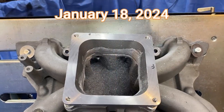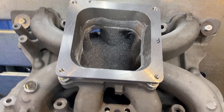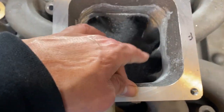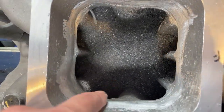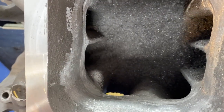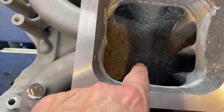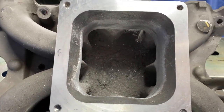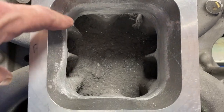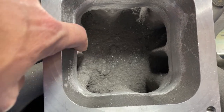Here's a little update - I think I got probably a total close to four or five hours on it right now, which is crazy. I had a quarter of an inch on this side to remove and like a sixteenth of an inch on the front and back. It's looking good - just a tiny little lip here. I'm going to finish with a sanding roll and then figure out how I'm going to angle this port entry, because it was probably about a 45. I may just smooth this out a little bit and keep it going down. Hopefully it looks a lot better cleaned up, but I still got a lot of finishing to do.